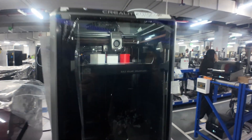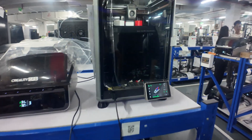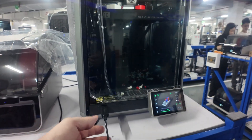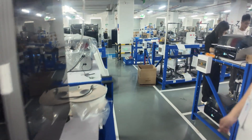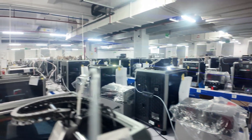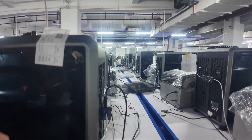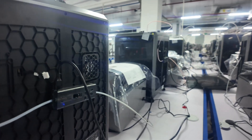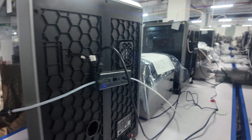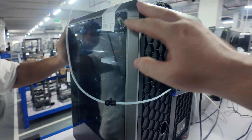Let me walk you through this a little bit. Just to show you, this is a K1C — K1 Max is exactly the same. The printer communicates with the CFS through the USB, so that cable is connected. If you look carefully, on the back of the CFS there, you can see another power cable. Down below, there is a power port on the CFS which we don't usually use on the K2 Plus, but for this upgrade kit you'll have to use a power cable on the CFS. It comes in the upgrade kit.